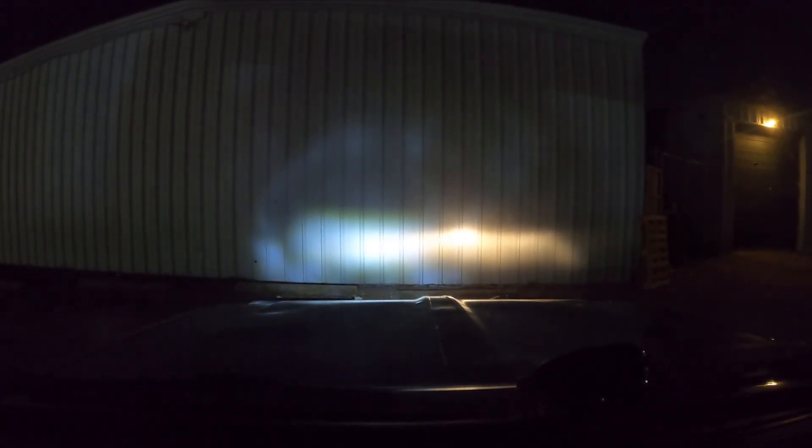It's obviously a brighter color, not as warm as a halogen. It does seem a little brighter. I did drive with just one installed on the way over here, but I had to adjust the headlight because it was pointing upwards — I adjusted it a little further down. You might need to go a little more down, but they're pretty much even right now. So far I'm really liking it — I'll find out once I have both in. The LED is now positioned correctly, pointing down instead of up.